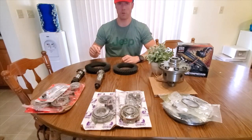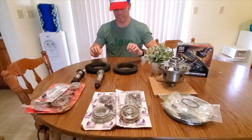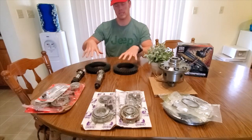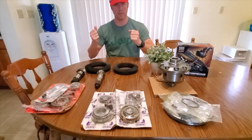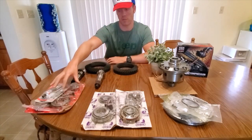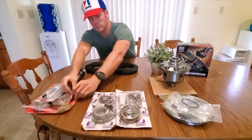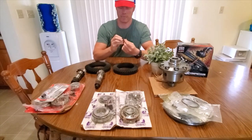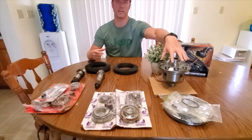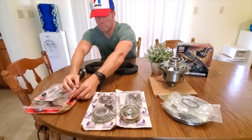For people who are just getting into this — when you purchase gears, there is so much to it. You really need to be well educated on what you're getting yourself into. When you buy gears, you're not just buying the gear set for $230 to $299. You need to spend that extra $100 to $200 for the bearings, seals, and also the ring gear bolts, because these are all brand new parts. The gears need a little anti-seize, and when they're installed you want to heat them up to fit over the carrier due to very tight, thousandths tolerances.